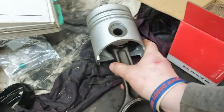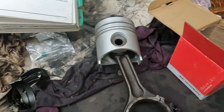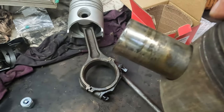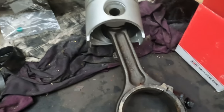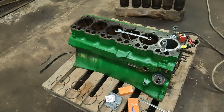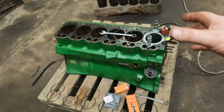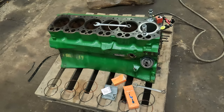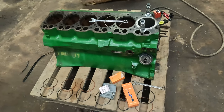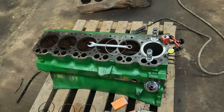I fitted a new piston onto its connecting rod - that's still fairly tight on there, which is good. It took a bit of getting that one out, but the new gudgeon pin comes with the piston anyway and that fits nicely. The rings will need to go on before we put them in. We've got to put the crank in, but I want to get all the liners in first, then flop it on its side and put the crank in. Hopefully I should be able to put the crank in like that, if not I'll have to try and work a way of flipping it right over.